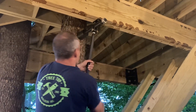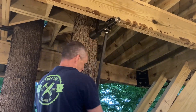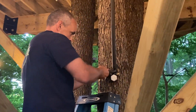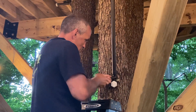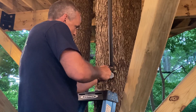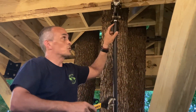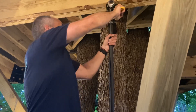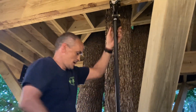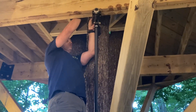Once I've hand-tightened it as far as I can go, I'm now going to take these jam nuts and rotate them until they make contact with the end of the strut body. This is what's going to lock the strut in place and make sure it doesn't go anywhere after installation. Using my open-ended adjustable wrench, I'll tighten them just so they're snug — tightening them to the strut body, not to the rod end. Now your strut is installed. I'm going to tighten up the little bolts on the top of the retrofit bracket to lock them in place.